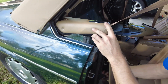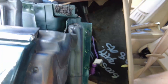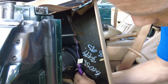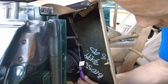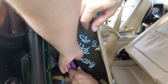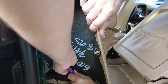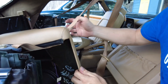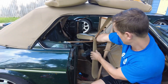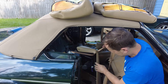On the other side, we've removed the top clip, hopped the panel up and over the sill plate, used a flat blade underneath, and wiggled and shimmied until the two clips popped. We looped the seat belt out of the way, then unplugged the speaker and the light — you have to press pretty hard to get those connectors out. And there we have it — easy as that, so we figured it out so you don't have to.